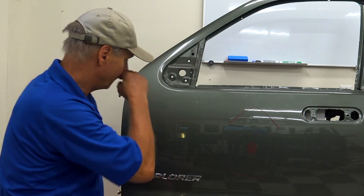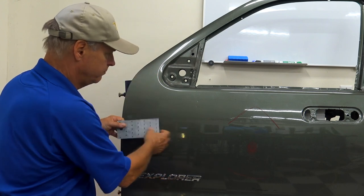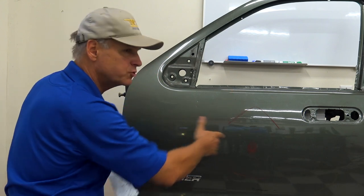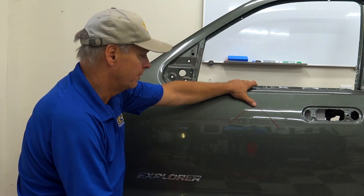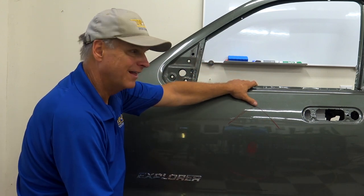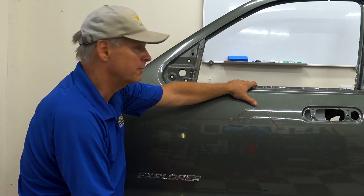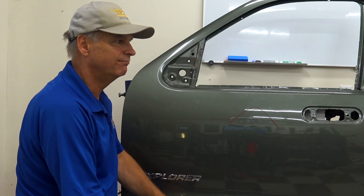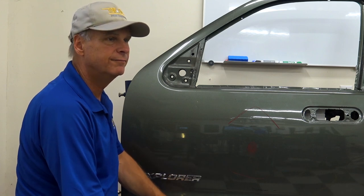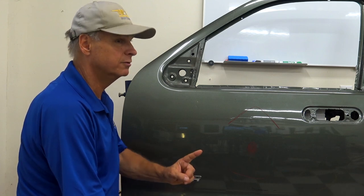That's right. So estimate where your breakover point is, put your tension on. If the crown stops, you stop, tap it down. Like I say, that's the beautiful part about 90 degree or less crowns. That's going to come out very quickly, very clean. You're going to be finished. That is not going to take any more than usually an hour, hour and a half. And that's when you can use tension.